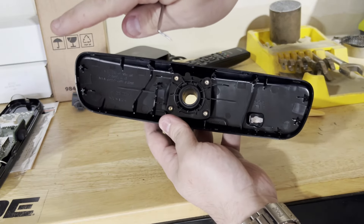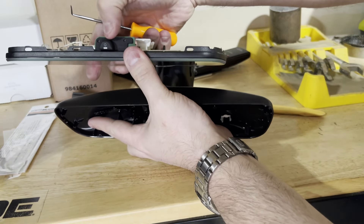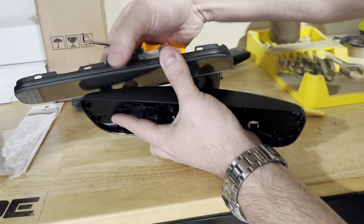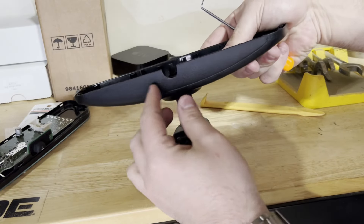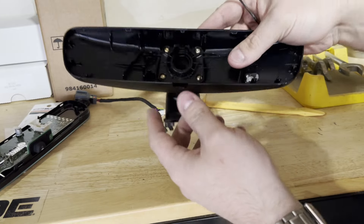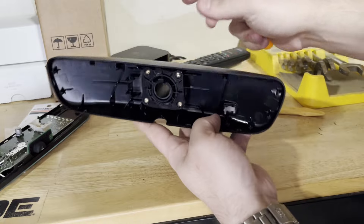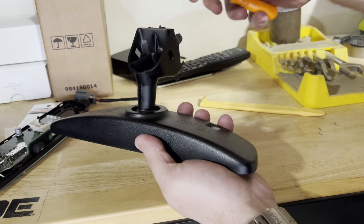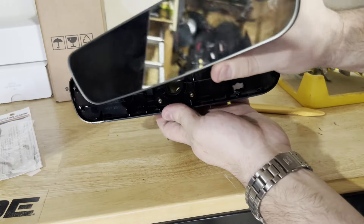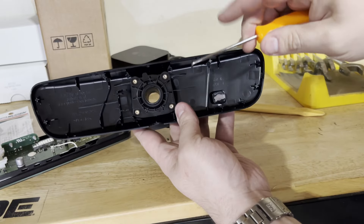You'll be using the clamshell from the Accord and the front mirror glass from the Accord — you'll know the difference because there will be four buttons: three for HomeLink and one for the rear auto dimmer. The Accord clamshell is also different because there's a hole cut for the stem and three additional holes or indentations cut for the HomeLink buttons. So we need to swap this stem out. This is the Accord stem; I already did this mod, so this is now the Integra mirror which only has one button, but the disassembly process is the same.